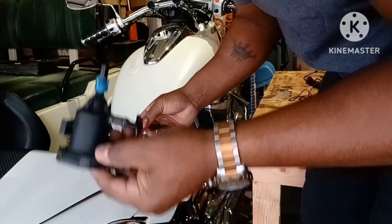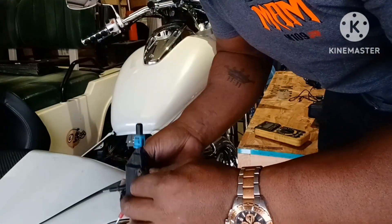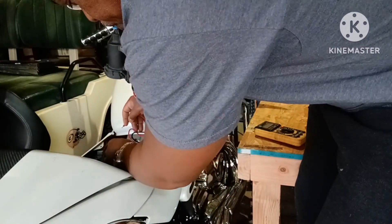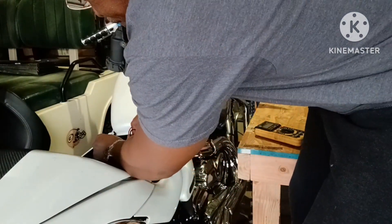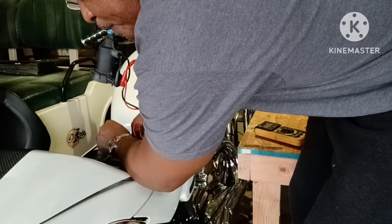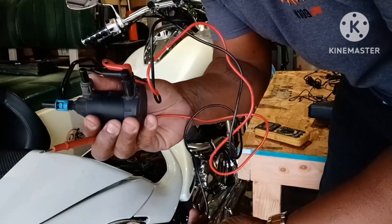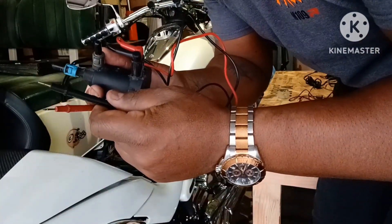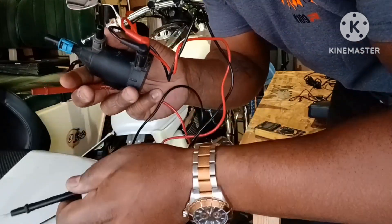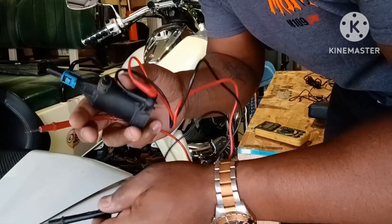So like I said, I can't blow it — you don't hear anything. But when I open it and apply power, every time I apply power this thing opens. As soon as I take power off, it closes. All I'm doing is touching my negative terminal back and forth on my battery while the positive stays connected, and you can hear it opening and closing as I'm blowing it.